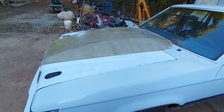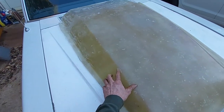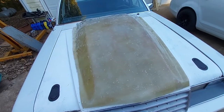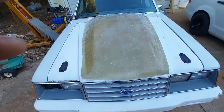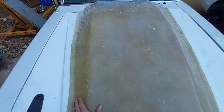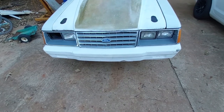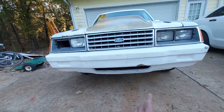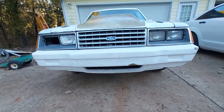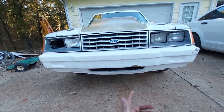This is the scoop I made that popped out of that mold. I did this one by myself and you can see a couple little places where there's a bubble, but it won't matter on this one because it'll end up being my plug — I'll shape it how I want it. That's the very first fiberglass bumper I made for these cars. You can see this spot and one over there — that very first one I didn't know what I was doing and couldn't get the mat rolled up tight enough to the gel coat, and that's what causes bubbles.